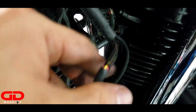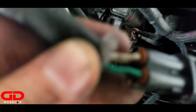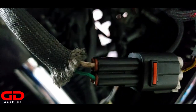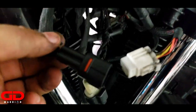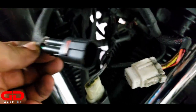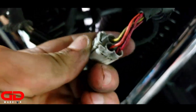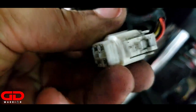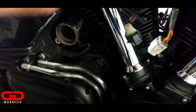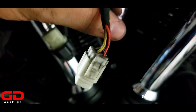Here is the cable coming from the Power Commander. This one goes in here — that's the one that goes from your bike's cable into the green and white connection. Here it is unplugged. So remember, this one comes from your bike's cable and it plugs into the one with the yellow, brown, reddish connector. Alright, next plug — we follow the Power Commander down. We got this one unplugged, let's go to the next one.